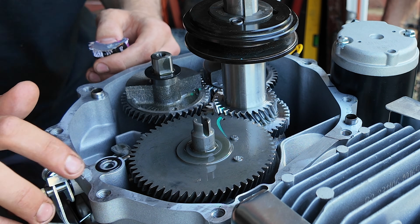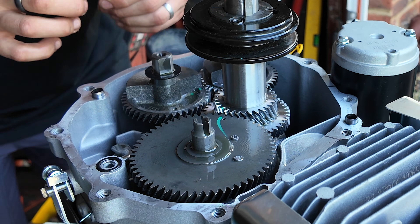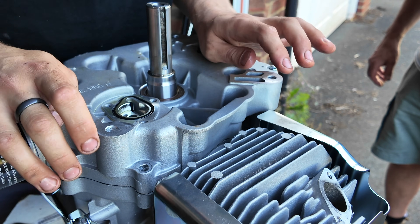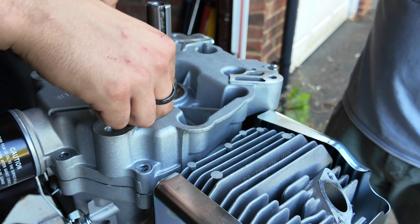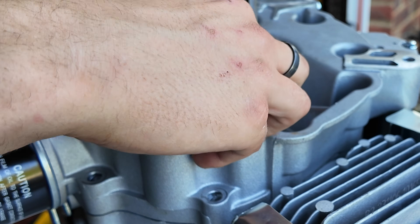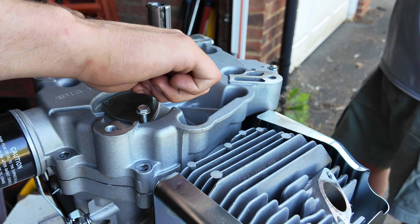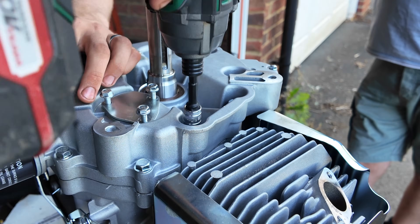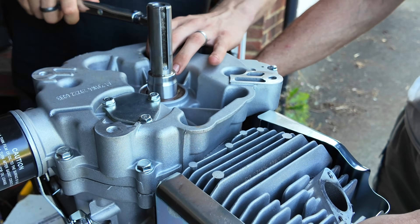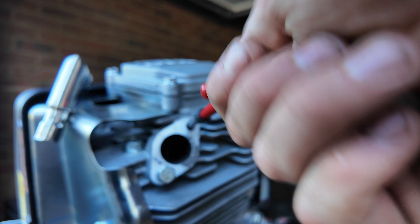Time to put it back together. We've got the O-ring here - this is easy to lose - popping that back on. The paper gasket comes off quite nicely when new but to be doubly sure I put some instant gasket on there to be 100% sure it's sealed. Then we've got the little oil pump - it comes with a strange square piece that slots in, a rod that goes down into the bottom of the engine, and a cover on top to seal it up. Three M6 bolts, then the 12mm bolts nipped up with a rattle gun and torqued up properly.